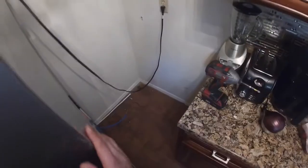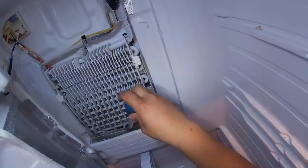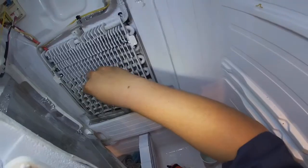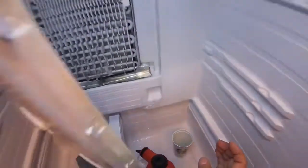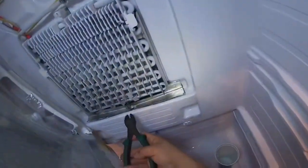Push the refrigerator back in place and work your way to put the drawers and all your stuff back. If you have a turkey baster, use it as a plunger — all technicians have one because they're pretty handy, a real life saver. We put some water there and now it's draining beautifully — the water goes down and that's exactly what we wanted. You can get one of these for a dollar or so at any store like Publix.